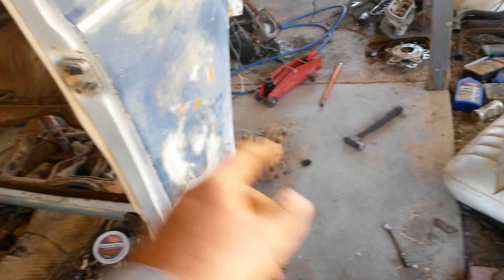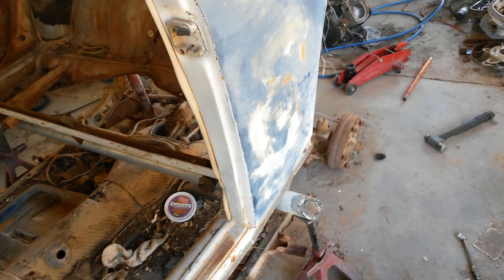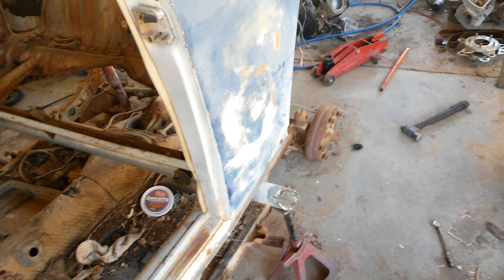So I'm going to do a lot of upgrades — disc brakes in the front. I'll do the wider Type 3 brakes in the rear, but I don't know how easy it's going to be to find parts. The drums I bought from Chirico in Tucson last time, and the backing plates. I actually took Type 3 fronts and modified them before, but since this is a street-driven car I'll have to find the Type 3 or Type 4 backing plates to make the car look decent.